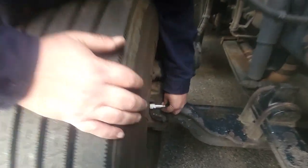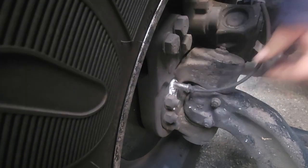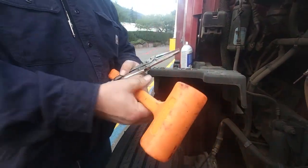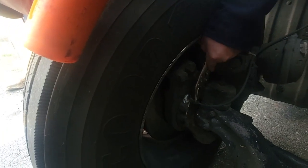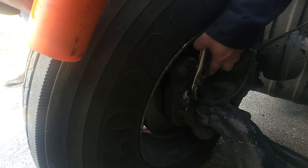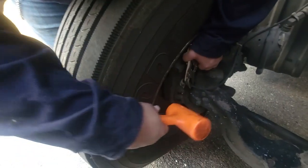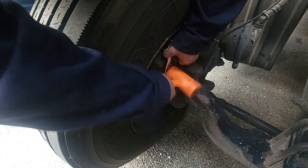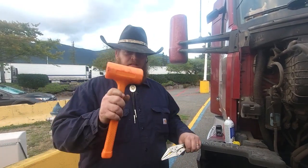Grease will not interfere with the operation of the wheel speed sensor at all. Just shove it in as far as you can by hand, then take your hammer and your pliers, go on the back side of that sensor. This is where you want to be careful — you have to be able to get the pliers on there, that's why I like these biscuit pliers. Place it against the wheel assembly itself so when you hit it with the hammer you're not smashing your fingers, and just tap it on in until it doesn't go any further. You don't have to hit it really hard — just barely tap it. If you hit it too hard you can damage the sensor and have to buy a new one. That's why I like a dead blow hammer — you can use kinetic force through your tools without damaging them.